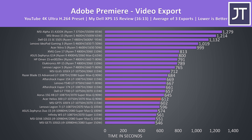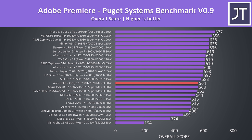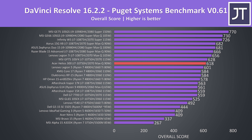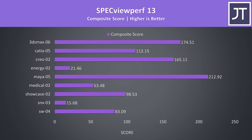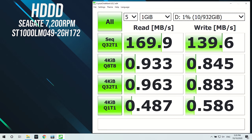I've used Adobe Premiere to export one of my laptop review videos at 4K — this is one of the better results, and the Helios was only being beaten by laptops with more powerful hardware. I've also tested Premiere with the Puget Systems benchmark — the Helios isn't as good here, though there's not too big of a difference between many of these machines. The results were similar in Adobe Photoshop, which tends to be more CPU focused, and despite the Cinebench results not being amazing, I was surprised to see it offering one of the best scores from a 6-core laptop. DaVinci Resolve is more GPU heavy, and the 90 watt 2070 is able to do fairly well, only being beaten by higher tier options. I've also tested Specviewperf for various professional 3D workloads. The 256GB NVMe M.2 SSD was decent, while the 1TB hard drive was performing like a spinning rust drive should.